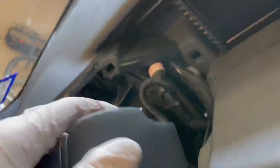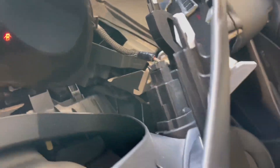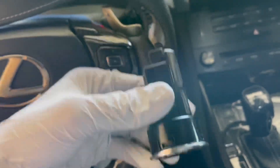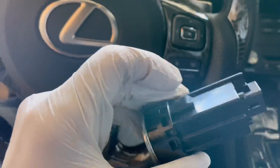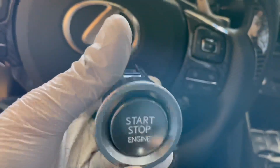That gives you great access right behind here — and this is exactly what I need to show you. This right here is what we're taking out. To visualize what you need to unclip: the piece sits kind of downward like this, and you need to unclip one clip on top and one on the bottom. First, undo the plug by pushing it and sliding it out — it comes out pretty easily.